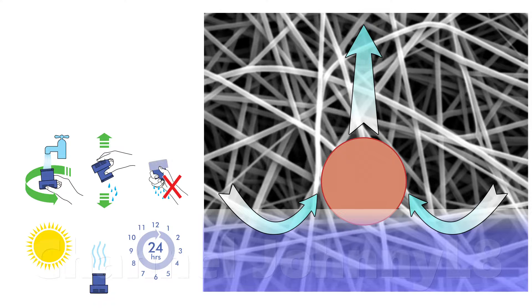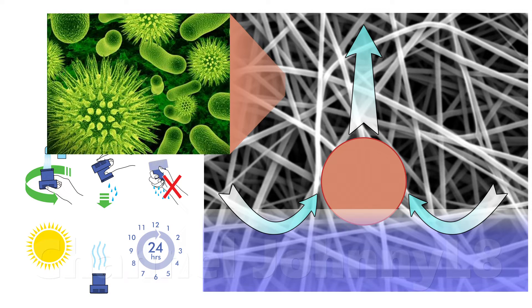In contrast, while blowing very hard with compressed air will remove many of the particles, there will still be many lodged in there because a filter will still trap particles even if the air is moving through very fast. This means blowing with a compressor may not restore all the suction, and the filter may clog more quickly next time. The second reason why filters should be rinsed is because water can help dissolve biological particles which can cause bad odours. This is much like why clothes are washed rather than being blown with a compressor.